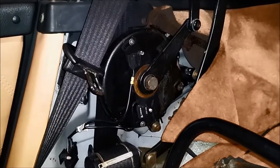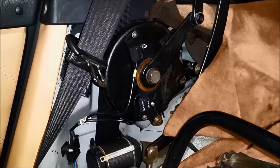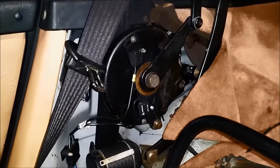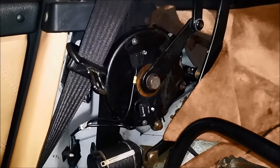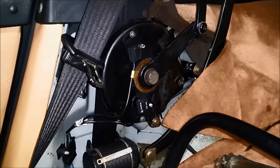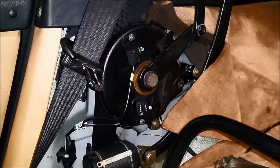Perfect. This one is a little bit different — if I try to roll the convertible top back again with the switch on the dash it's not going to work anymore. I actually have to go forwards a little bit and then it can go back. That's how you know that these two micro switches are working properly and the convertible top unit is getting the signals from them.